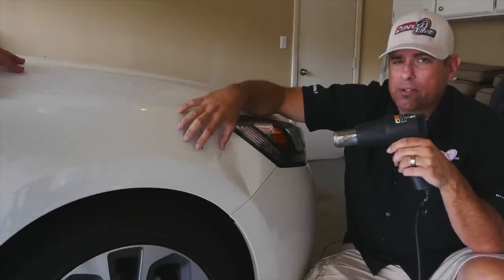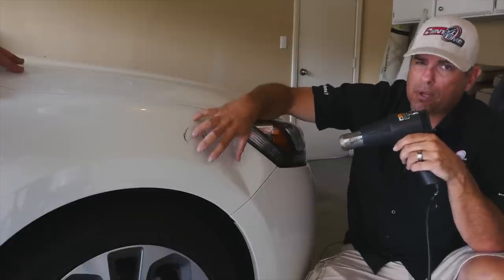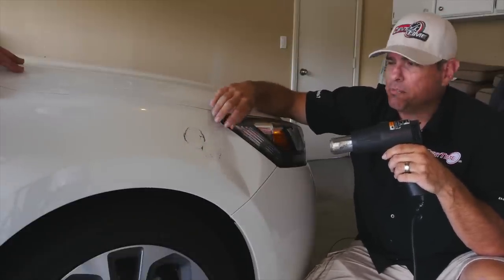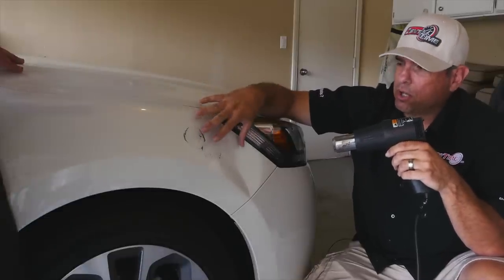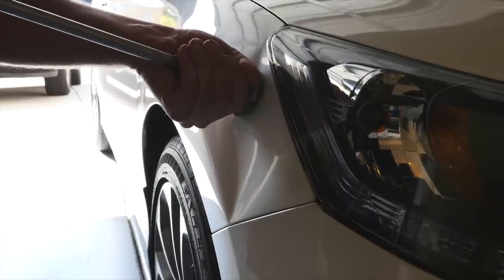John set up from outside going in because we're letting the process do the work, pushing the metal back into the seam right here. If you tried to pull the seam first it might have reversed and you could have cracked paint or locked pressure. So far so good — it's coming out. Just starting that a little bit below the corner.